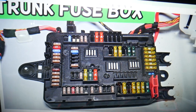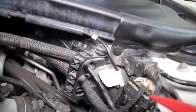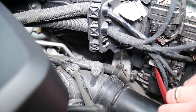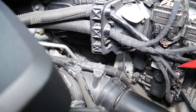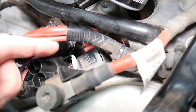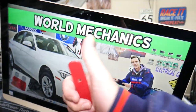Then we have two more fuse boxes. One is right next to the shock tower on the driver's side — this is the power distribution box. Here you have an integrated relay fuse on top, and then five more fuses. That fuse on top is one for the powertrain, and the third one here as well. It's a sealed box — some people open it, replace the fuse, and seal it back together; others just replace the whole assembly. There's another one here as well that has powertrain fuses integrated. Those are the hidden ones. Hopefully the video was helpful — thank you for watching, see you next time.